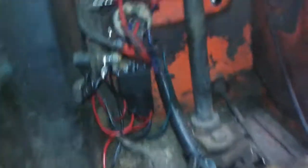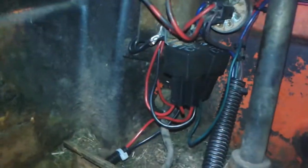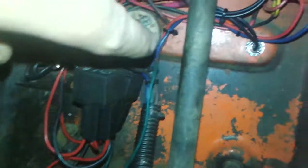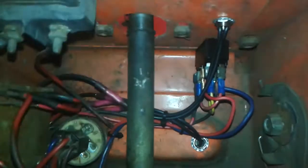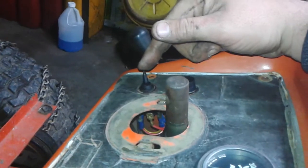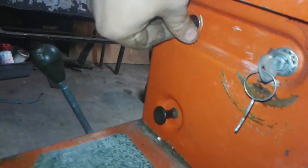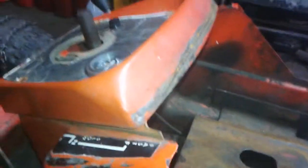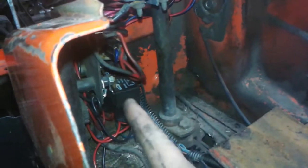Let me show you what I had done with the electrical. I added two relays in here — one's back here, one's up here — and I added some switches. There's one switch here and one switch up there. The one on the top operates the PTO and the one on the bottom operates the lights. Both of them are rotary style switches, so when you have the electric lift that goes up and down, you don't get the PTO switch mixed up with the attachment lift switch. And down here, since you're getting on and off the tractor, I didn't want a toggle switch that was going to get kicked, so this is a rotary switch that's not going to get kicked on or off or broken — it's pretty stout, a well-built switch. I'll put links in the description for those as well as for these relays.